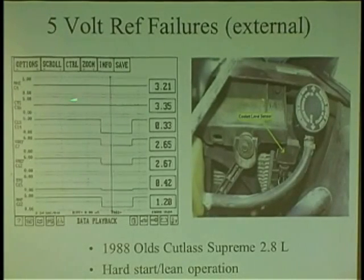You know, here's an indication. Look, here's a coolant level sensor in a GM car. 3-wire sensor. Has the 5 volts in there. The coolant went bad, seeped into the sensor and go, hey, 5 volts, hey, ground, you guys want to dance around a while? Okay, stuck his nose in there. And now they're shorted, like this. And guess what? It affects anything on that 5-volt line. It'll pull down, because anything that gets 5 volts, it can either shut down the car or make everything go lower than it should be.